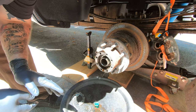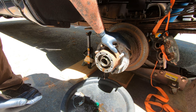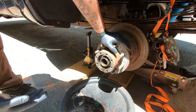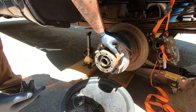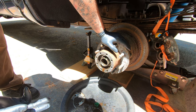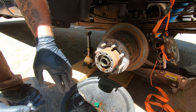I'm not changing the bearings — I'm going to repack them. This is a full floating, oil bath hub, but I will be greasing these bearings before I put them back in. The manual states to grease them even though it's oil bath, which is odd because it's the same axle as in a Chevy and Chevy doesn't state to grease them. I'm going to do both — tilt each side to let the oil flow. So you're going to repack these with grease before you put it back together.